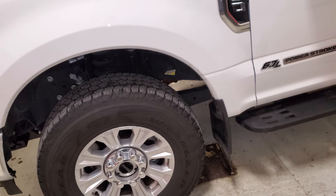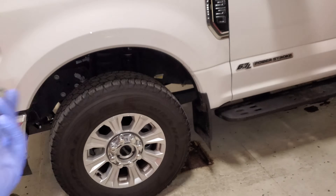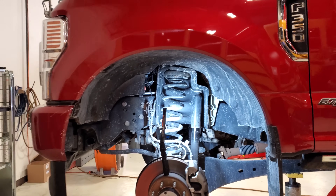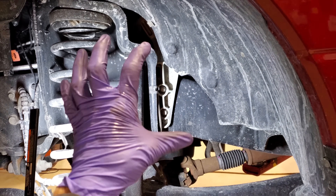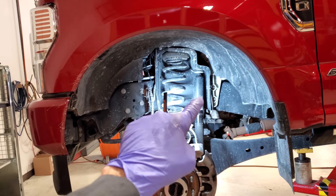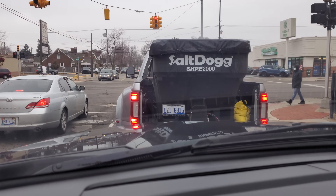The system this functions within is called Adaptive Steering. For those who don't know what that is, here's a quick overview from the workshop manual verbatim: the adaptive steering system provides steering assist to the driver by dynamically changing the steering ratio between the steering wheel and the road wheels, thereby reducing the number of steering wheel turns required to turn the road wheels. This is accomplished through the use of a motor, worm gear, and a toothed hub. All adaptive steering system components are inside the steering wheel, behind the driver airbag.